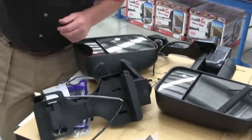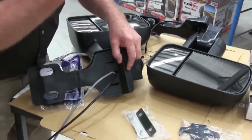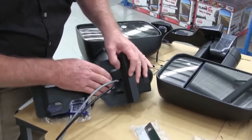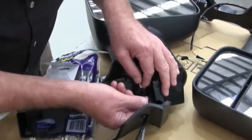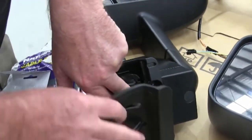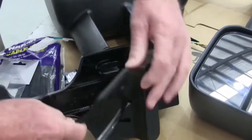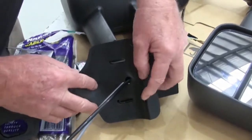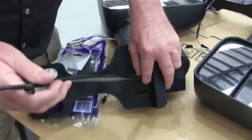When you're wiring this up, you need to mark some holes on the door — which is what we've done on this cruiser over here — and then fit your rubber and everything into place. What we like to do is hide this joiner for the grey sheath and the black sheath back in the low spot inside the door, so when you put your rubber on, it's not caught up across the mounting point and shear the wire off. When you put this back on, that'll be in there. You've got a tonne of wire here, which will come out the door.